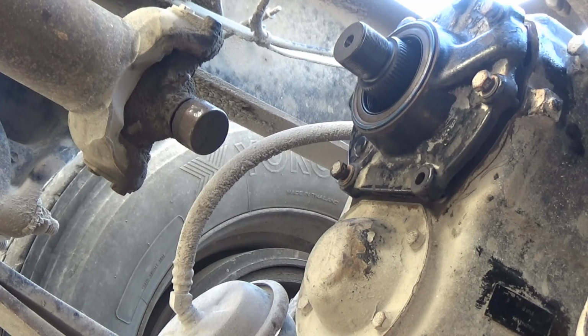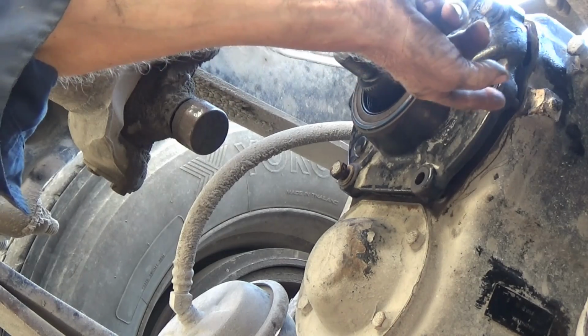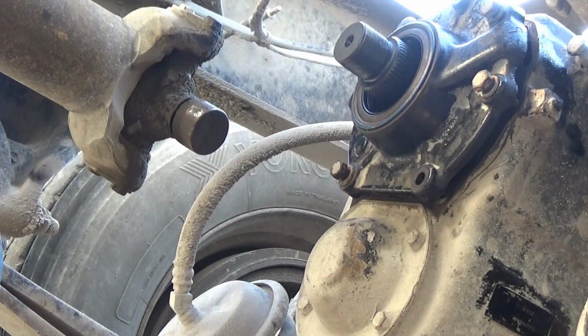It's on now, and now that it's in position, I gotta leave myself, this is my first time doing it, but I'm going to guess, leave myself about 1/4 inch, 3/8 of an inch gap, and then slip some shims in there. I've got to put too many shims in and then start taking them out. I got to tighten it, loosen it up, take shims out, tighten it, check it, and keep doing that till I get the right number of shims in there where it just doesn't move up and down.